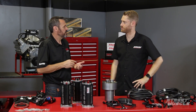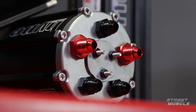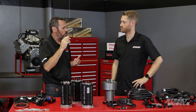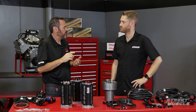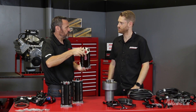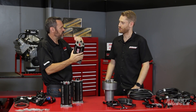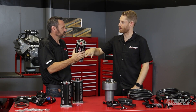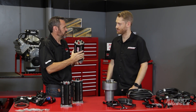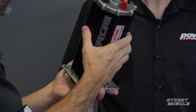Some guys will be converting from a carburetor system or may already have an EFI system, but the trick is you're going to remove the regulator. You can use a carburetor pump or an EFI pump, but you remove the regulator and run the fuel pump unrestricted. The surge tank is filled with low pressure and can be mounted straight up, at a 45-degree angle, or various orientations — all the fuel is being re-purged out. Even if you pick up a pocket of air in your existing gas tank it'll be purged out, because air sits at the top and the pickups are on the bottom, so you're never getting air near the pickups. Hitting bumps, pulling a high corner, going into a slalom and sloshing fuel around — this tank is constantly staying fueled.